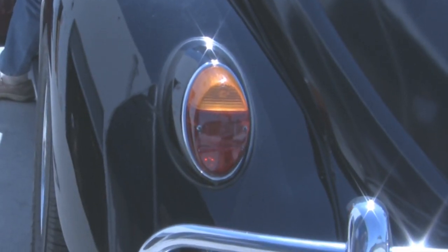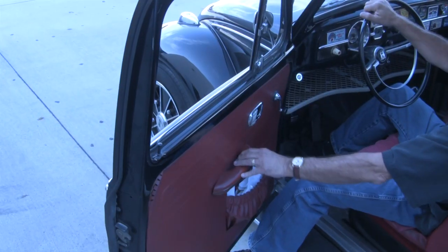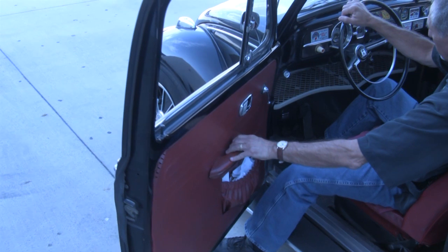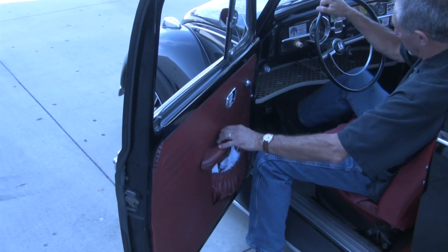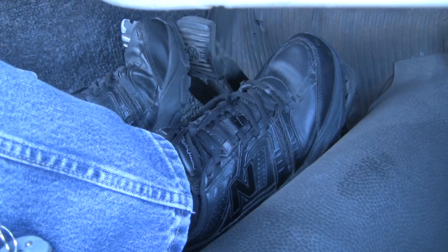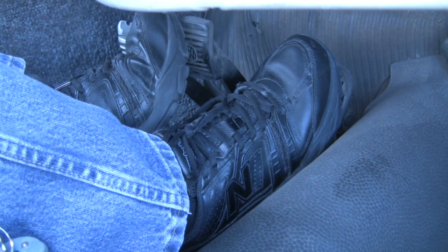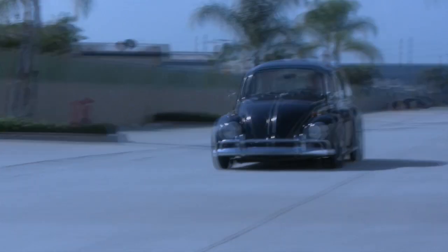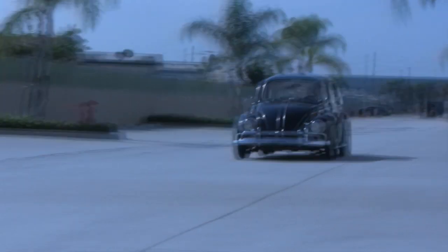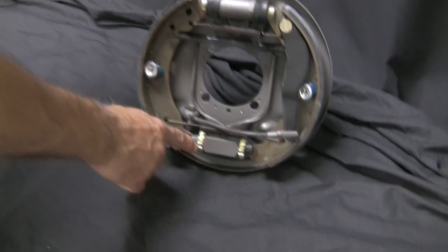If you have completed bleeding the system and have a high, firm pedal, then you are ready to test your new brakes. Make certain that your emergency brake is adjusted and functional, then manually rock the car back and forth just a foot at a time and apply the brakes. Once you are confident that your brakes are functioning, start your car and carefully and slowly drive into a clear or empty street with your hand on the e-brake just in case, and check to be certain you have braking power. Drive about 25 miles per hour with your foot lightly on the brake pedal to help seat the shoes to the drums and the pads to the rotors. Don't do any panic stops until you have a few miles on the new system to mate the pads and shoes. Then go ahead and roll up to about 25 mph and carefully execute a panic stop. The first thing you will notice is how straight the disc brakes will stop you, and you never have to adjust them again.